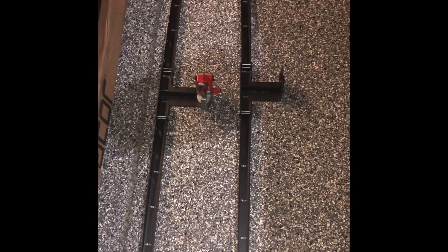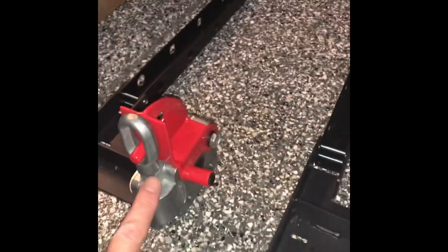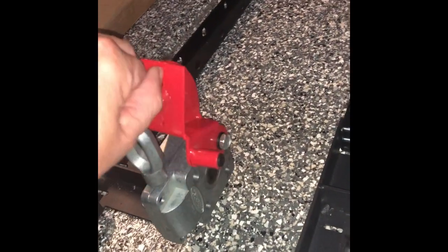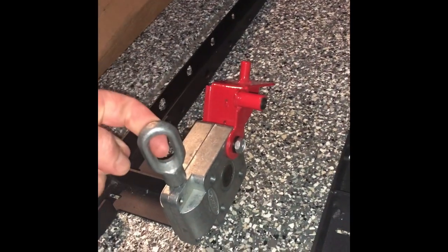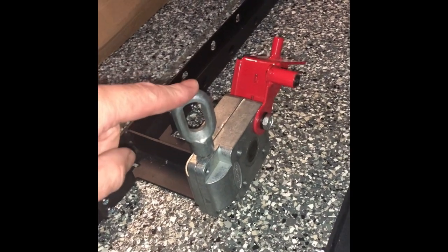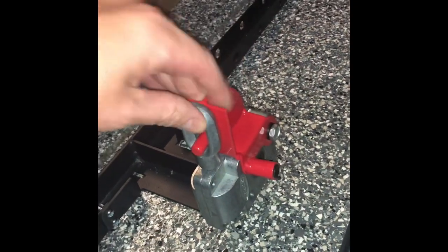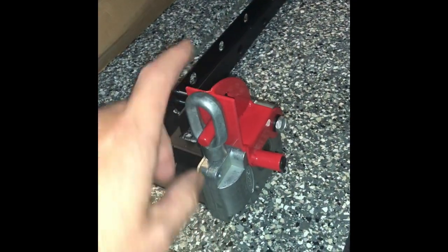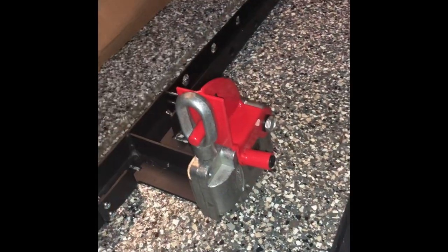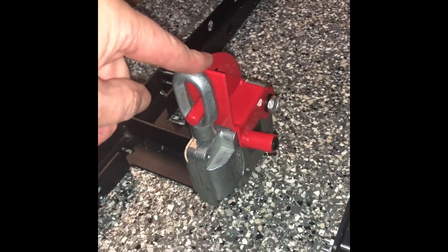As you can see I've already assembled the front and the rear assembly — they're practically identical. The only difference is this piece here which contains a locking mechanism that can be popped out. This is where the pole will be engaged, and I'm going to use the drill driver adapter. This part allows you to raise and lower the heavy-duty rack, and this metal piece allows it to remain locked in place. It's a nice physical lock — very heavy-duty metal, so I'm not worried about the lift unwinding and letting the load come down unexpectedly.